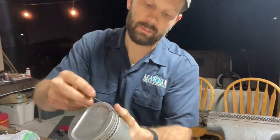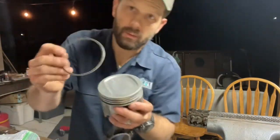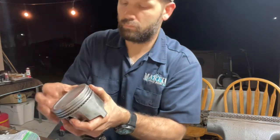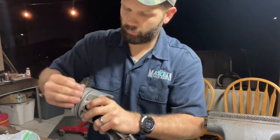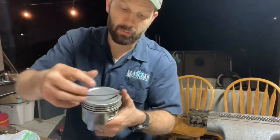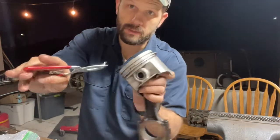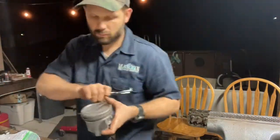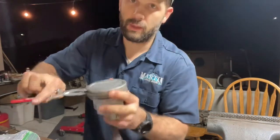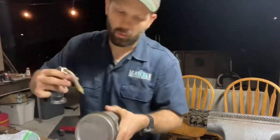This one goes underneath the oil ring. Then this other ring goes on top of the oil ring. The ring with the 2 dots goes below. Makes the job a lot easier when you have the right tool. I always turn my pistons 90 degrees to keep the gap in the rings away from each other. At this point, we have the rings installed. We'll oil them now.